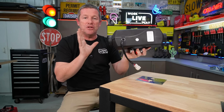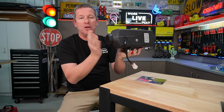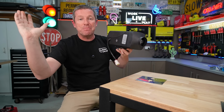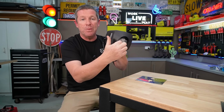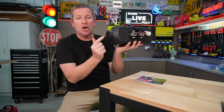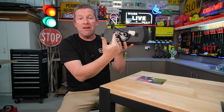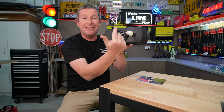So inside your camp trailer or your caravan, you're taking the warm air, I would say, in through this side. It's heating it up and expelling it out through the duct and into your caravan or camp trailer from the open side. Now, if you take that same theory, when you look underneath, there's two ports underneath. Your cold side is also your cold in, which is your air intake for the combustion chamber, and then the hot side is your exhaust out.